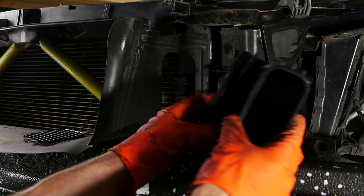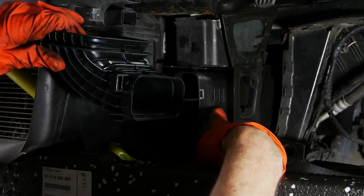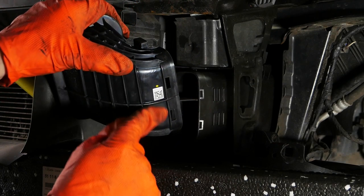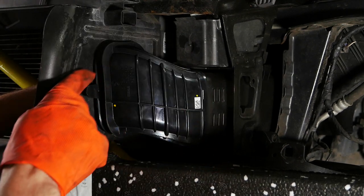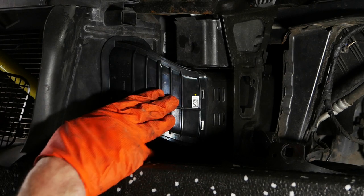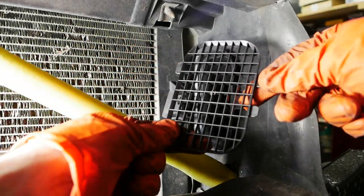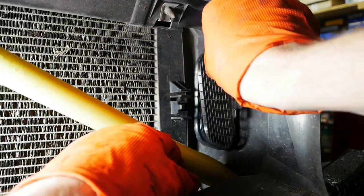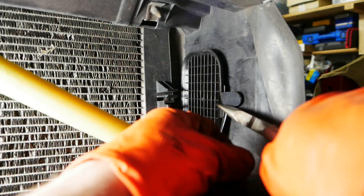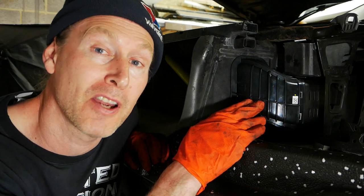So here is where your intake should be sitting - it runs into your air box. You can see that's rigid now because I've clipped it on at the back properly. Now all we have to do is pop off this little hatch - it just has these little clips and comes out just like that. We've got this elbow: the small side goes on to the end of the pipe that runs to your air box, and you can see little tabs - two of them on the front edge and another two at the back - and they just pop through the corresponding holes on your pipe. At the same time you have to be feeding this rubber part through this plastic cowling. Then this grille only goes on one way because it has big tabs on one side and small ones on the other, corresponding to holes in the rubber piece - feed it on at the back then stretch the rubber tab to get those in. That's how to fit the BMW hot climate cold air intake.